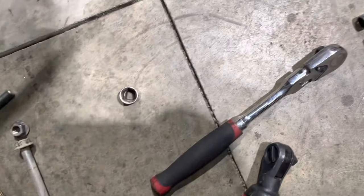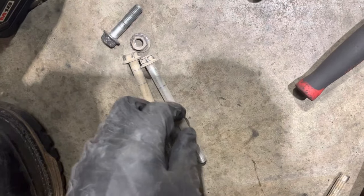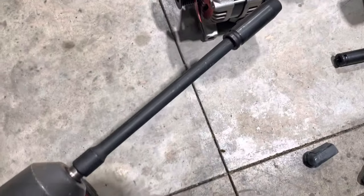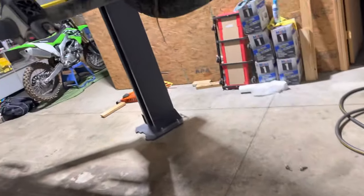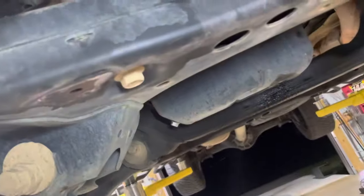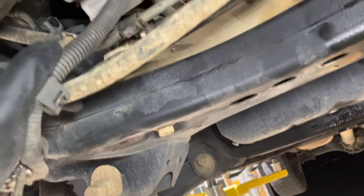Short 14, long 14 — these are the two bolts, long and short, and a stud that's in there. I used a long half-inch extension to get those two out, and I'll show you where it's at from underneath. You pull your belly panel underneath, drop the four bolts — those are 17s on the sway bar — drop the sway bar down.